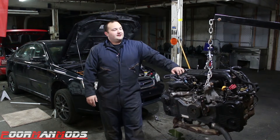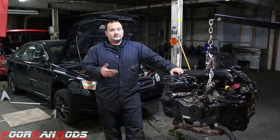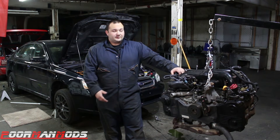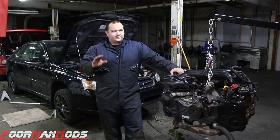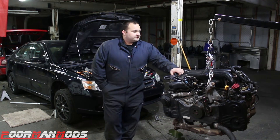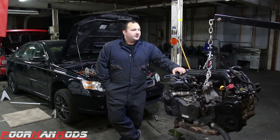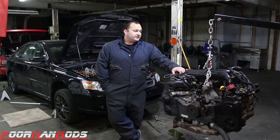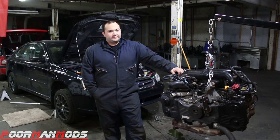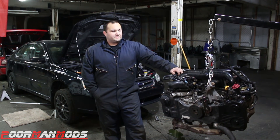We finally got the engine out. It was a little tricky getting it off — there are super long studs on the bottom. Hopefully this video helped you out. When I was looking to do this I couldn't really find a detailed video on it. This process is probably very similar to every Subaru engine, except the STI has a pin in the transmission that this car does not have — make sure you remove that. For first timers, at least two people are recommended — we had three people here. An experienced Subaru guy can do it by himself, but for a first timer you definitely want at least one friend. Now it's time to rip the clutch and flywheel off and put it on the engine stand for the next video. Hope you learned something. Hope you enjoyed it. Peace.